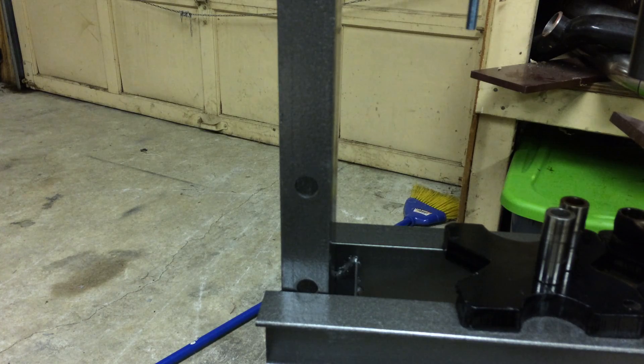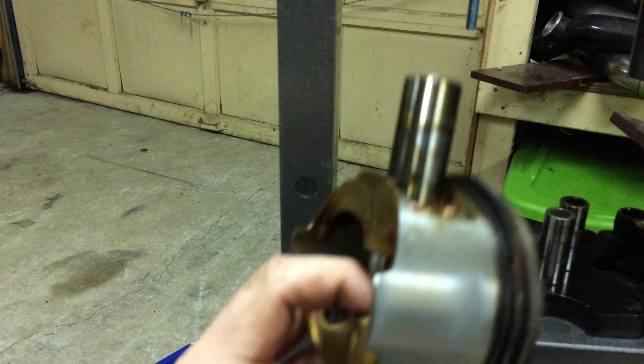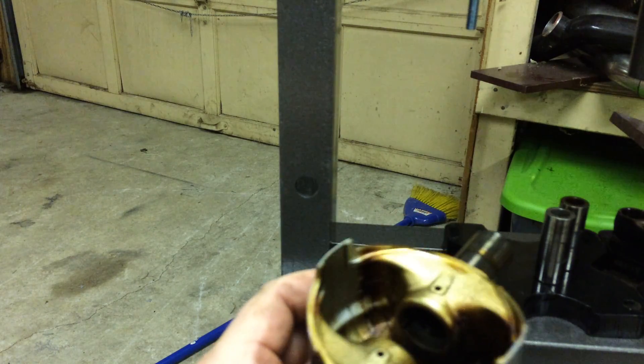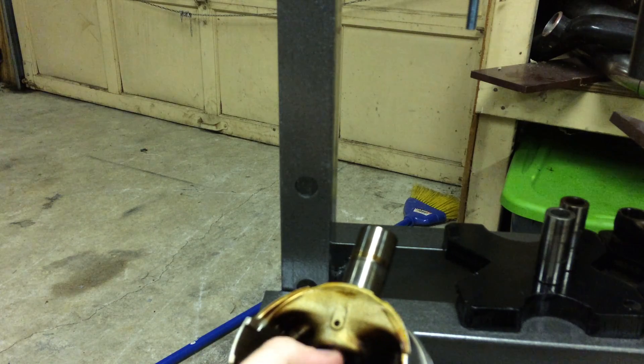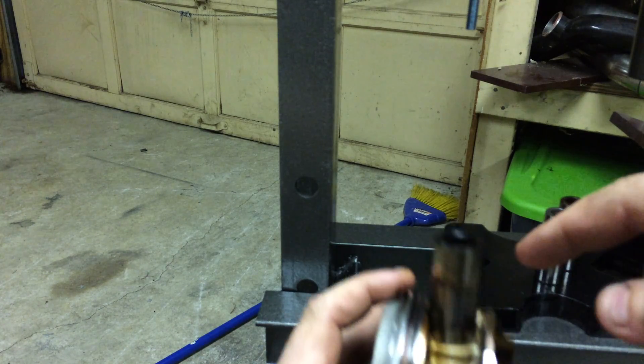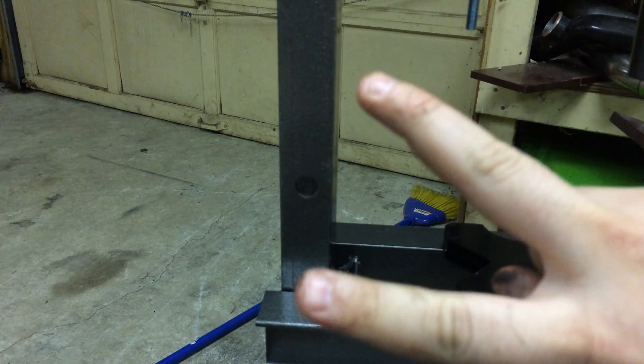I'm not going to drag on here — we'll talk about it in the next video guys. There's some piston pressing for you. I didn't show you how to put them on, but it's the same thing just in reverse. If you go to my other video — I'll leave a link in the cards — you can see the same steps used for floating wrist pins. You put it on, nub it in there a little bit, get it socketed into place, then put it back on the press and go from there. I might even make a follow-up video tomorrow. Alright guys, thanks for watching — peace!